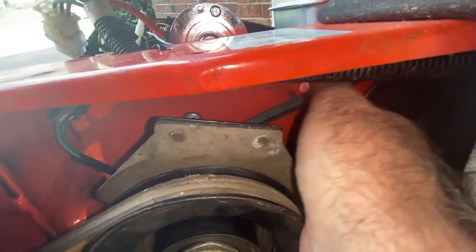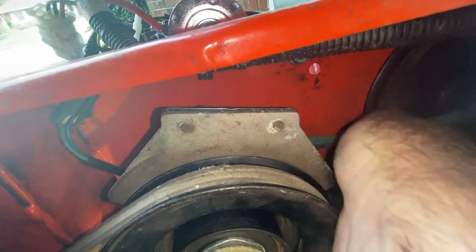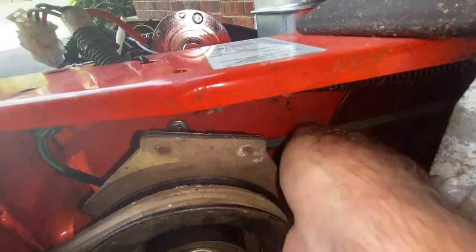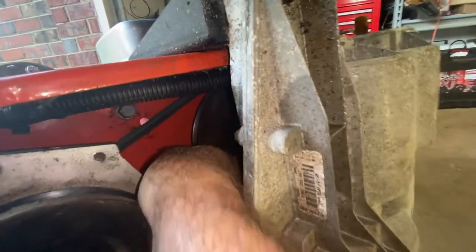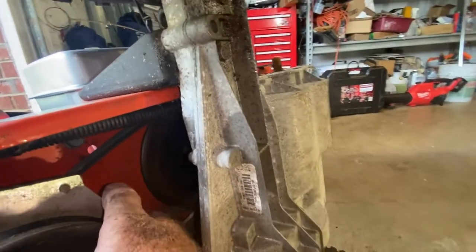Here's the belt — I'll show how it's loose around the clutch. See how that's popped up there? I pull it tight across the clutch and make sure that it stays inside the belt guide. Then I simply work up here, get it around the drive clutch as much as I can, and walk the transmission backwards a little bit so that I can start the belt over it and it should pop back down.